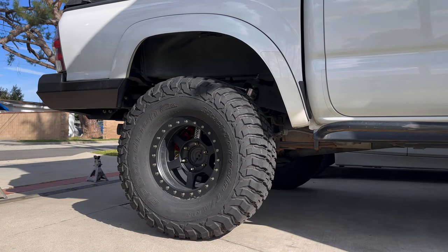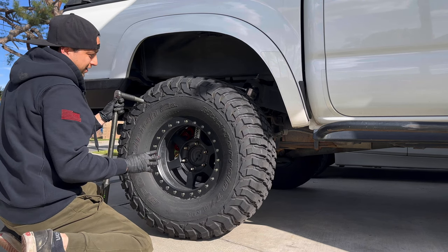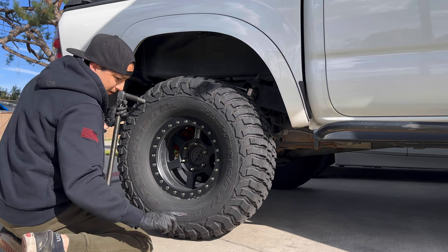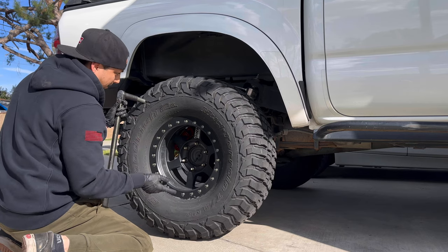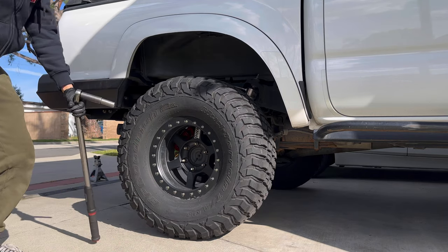All right, I'm just doing a double pass to make sure that the wheel is seated onto that spacer. That spacer is cut super tight. I have to hit it on the wheel a little bit. And even when I impacted it on with the very small 3/8, it still didn't seat it. So that's why you saw me work around a lot more than it would have with a 1/2-inch impact. But that's good to go.